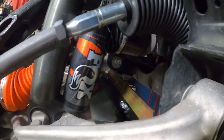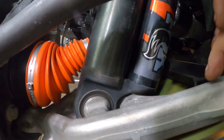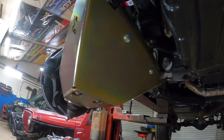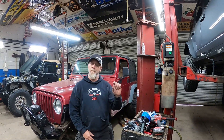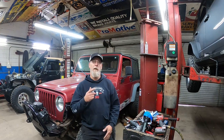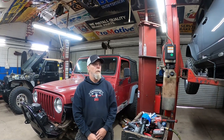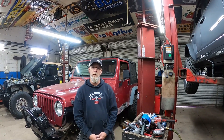As you can see, it's clearanced to go around the shock, the little stanchion goes down to the control arm and keeps it nice and tight and squeezed — we painted it all up. While those brackets definitely weren't made for this vehicle, the disclaimer was right there on their website. With a plasma cutter, a welder, and some spare steel we were able to make it work — and it actually works really well. Armor Light's going to enjoy that; they're going to like knowing they can actually use this vehicle and not destroy everything underneath of it. We've got a few more things we need to strengthen up and beef up on this vehicle, so if you stick around for next week we'll have some more cool installs. See you then.